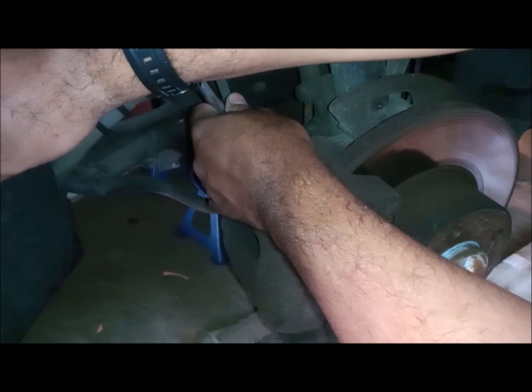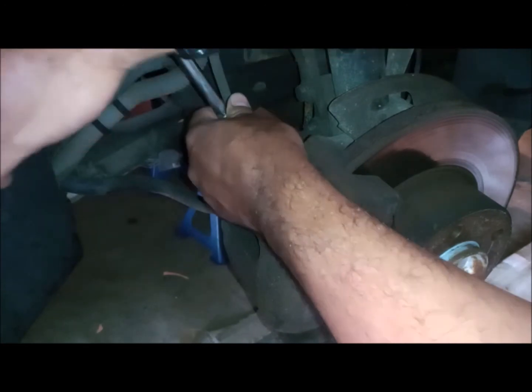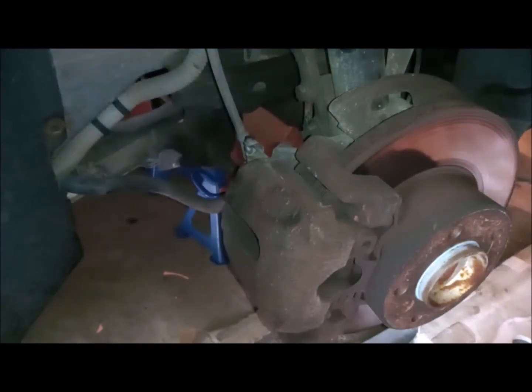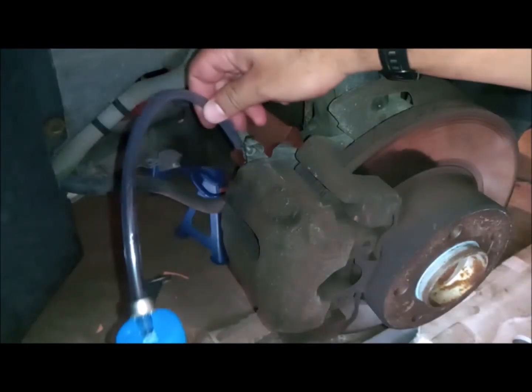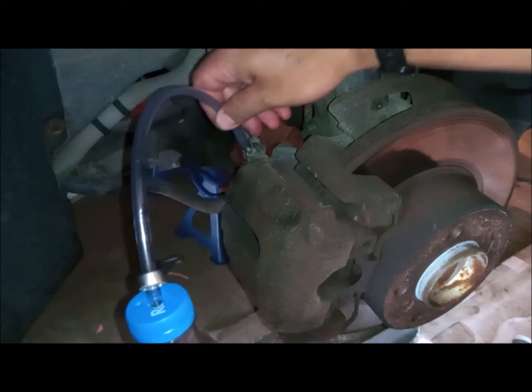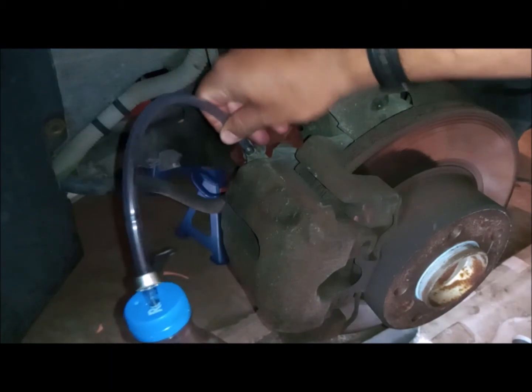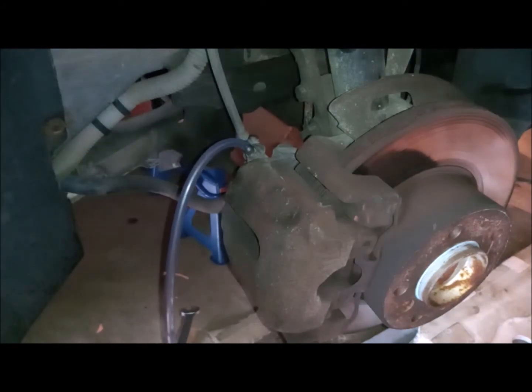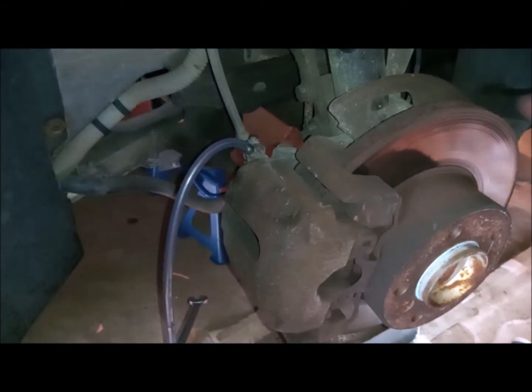So this will make it steady. I'm using the caliper as support, and I will just open it a quarter turn, and that's it. This is enough for me to continue with the manual wrench, the ring. So immediately I'll put my fish tank tube here, which fits perfectly, and I will wait, of course. Now